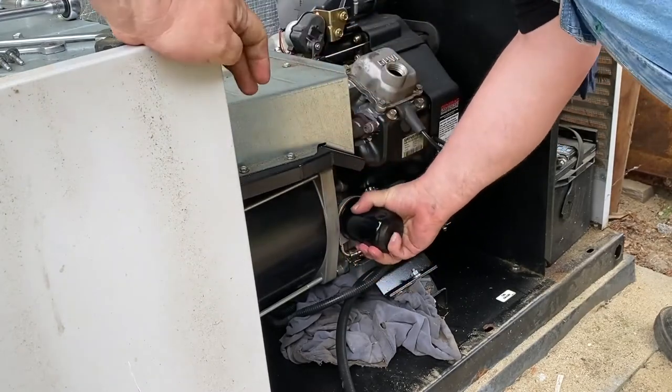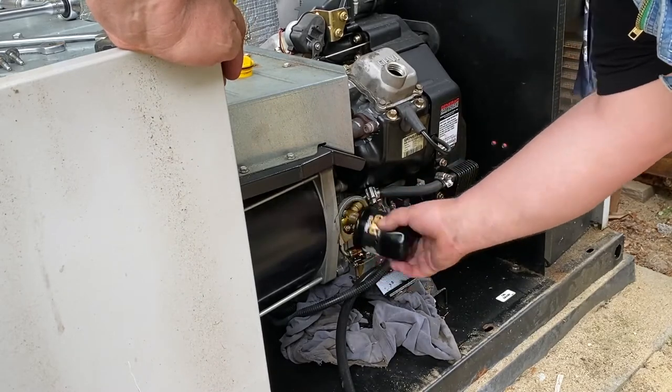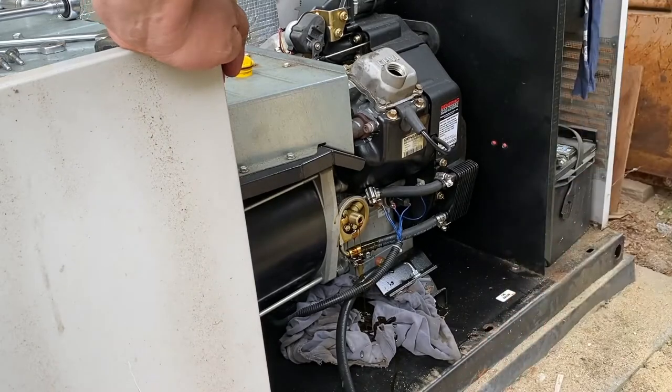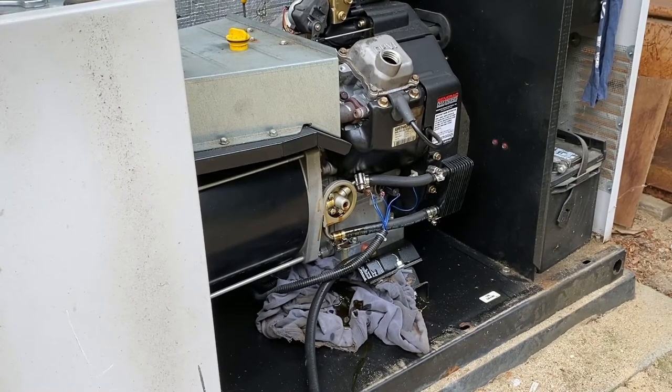Nothing's on that tight. You shouldn't put these on much more than hand tight, but for some reason this one gets tighter as time goes on — I don't know why. Of course that makes a mess every time. We have to let all that oil run out. I really try to get as much of the used oil out as I can. I like to take care of our small engines — we put a lot of money into this one. This machine is probably 20 years old; one new cylinder head last year and the generator unit itself was rebuilt last year.